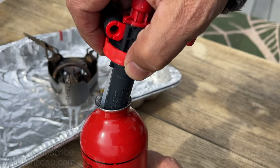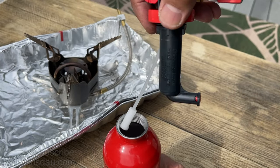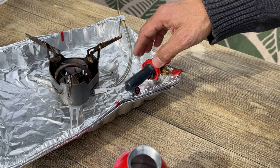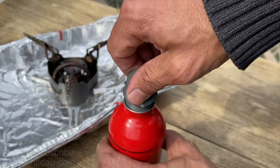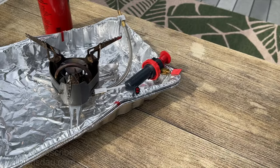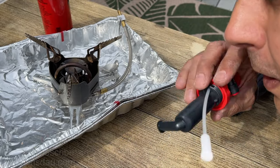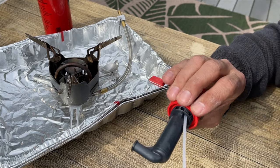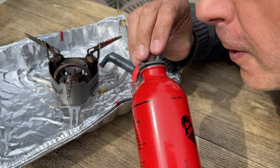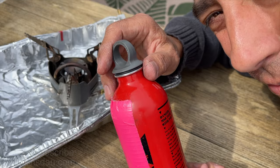Open this bad boy up very, very carefully. Take it out. Tap the filter stone off. See that fuel here? Blow on it. Make sure to put the lid on the fuel bottle too - it's so easy to dump the fuel bottle over, been there done that. Blow off everything - it'll make you lightheaded, but it will save you later. Your bottle will also be covered in fuel, so blow it and that'll cause the fuel to evaporate so you have a completely clean surface.